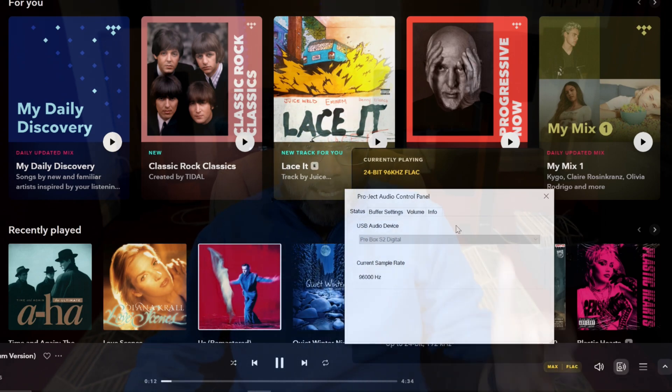Now once you're playing, everything is set up. You just have to make sure you are in either Pure Direct or Analog Direct mode on your receiver — whatever your receiver calls it when it comes to pure audio — meaning audio that's not going through Audyssey or any other room correction software your receiver might have. If you put this analog sound through room correction, it's going to convert it to digital, and now you're not listening to the actual sampling rates your DAC is producing. You don't want to go digital-to-analog in the DAC and then analog-to-digital again in your receiver.